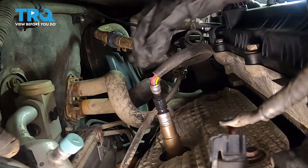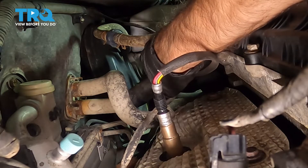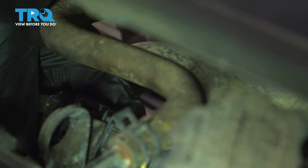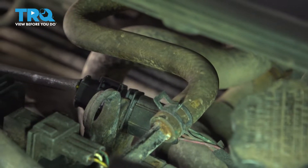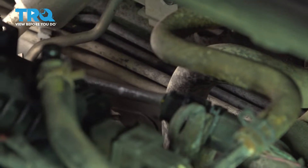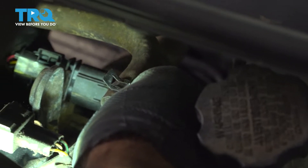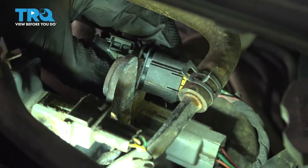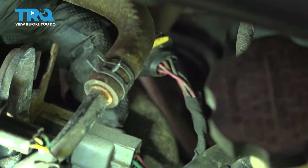Now we're on the top side of the motor. This cable here comes up from our old O2 sensor, and if we follow this forward to this gray plug here — the gray plug is the vehicle side, the black plug is the one we need. So what we're going to do is remove it from this metal tab which is on the vehicle. We're going to use a pick tool and try to get underneath that metal tab. We'll lift up that metal tab and push our black plug forward. Sometimes there's a hole in there you can push down in the center. We can also remove our top O2 sensor plug from the bracket and just set that aside — it'll give us a little bit more room to work here.